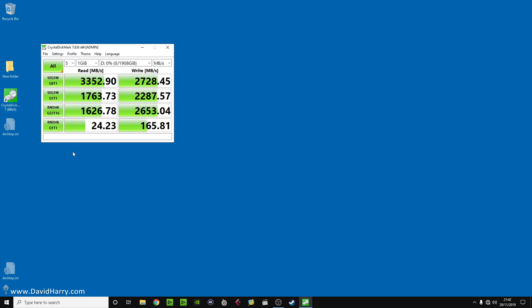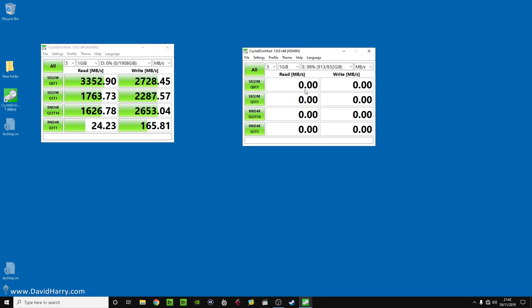Now I'll do the same test for my Samsung drive — the E drive. I'll run CrystalDiskMark and get to the end to see the top line speeds, then compare that to the Sabrent. We'll then do the real world disk test, because these synthetic figures definitely are not tallying up with the real world disk speed test — as in proper data dumping and copying files. These figures just do not translate whatsoever.